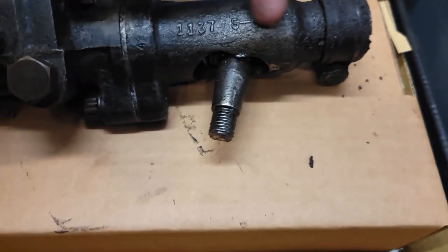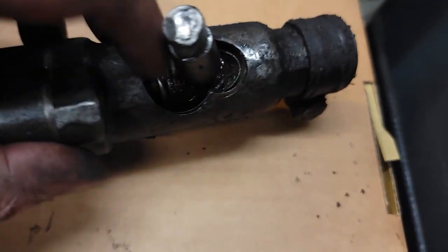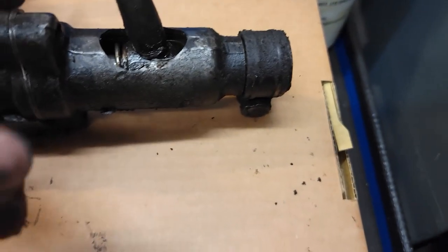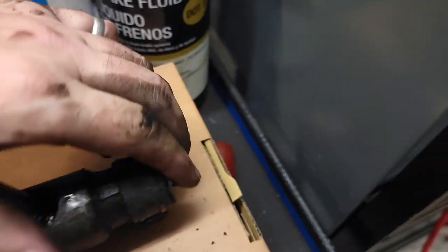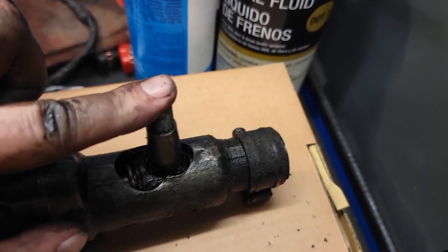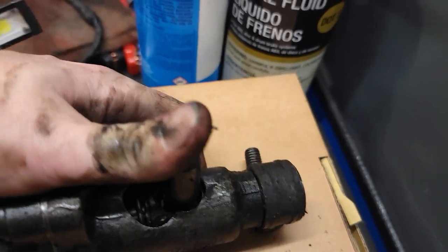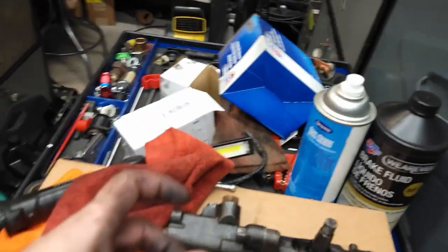On that, the new one, this thing, straight out. This is a ball in here. It's under pressure in that one. It's under pressure by a heavy spring right here. This one, the fluid tube and a spring, which would put more pressure on this, because right now, that's pretty effortless, and it's just spinning. It still ain't moving nothing. I can do that without this moving. This is supposed to just take up, it's supposed to be held in there hard. And when you steer and push on that, it's supposed to push this way and push that way with very little flex. And if I can do that with my hand just easy, obviously there was something wrong with it. So going to the manual one, fingers crossed, I'll take you up into, we'll look at the steering wheel again and see what's going on.